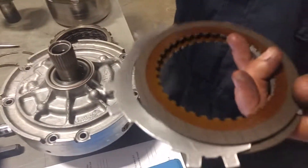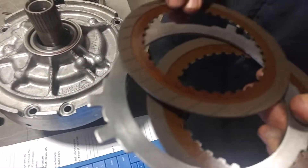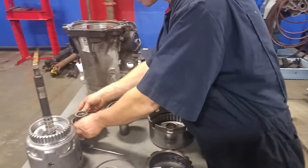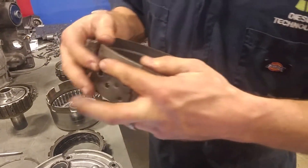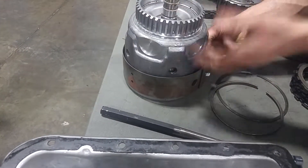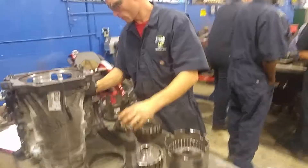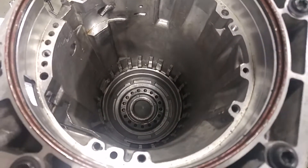These ones here show nicely how the grooves allow fluid to come in and out. Inspect the gear, inspect the plates — look for even wear on any of the friction material, and no excess wear on the gear teeth. This here is your brake band — it helps engage and disengage some of the clutches. This sits up around and through here, and once it engages it tightens up, stops rotation, and transfers some of the power flow to different clutches. You also have spring clamps — these help hold all the components together, so make sure there's still tension on them.